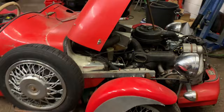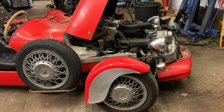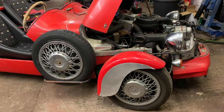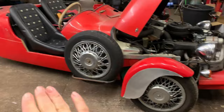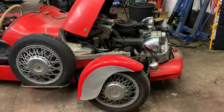I haven't actually had a proper look underneath this so you'll be looking at it with fresh eyes as I am. I'm going to jack it up and see what it's like underneath - I'm hoping the chassis is good because I'll be very upset if it isn't, as that would mean welding. Especially if I get into Race the Waves, it's probably not a good idea to be racing a corroded chassis on salt water. I had a quick look and there's a shock absorber that looks like the boot has split and it's leaking.